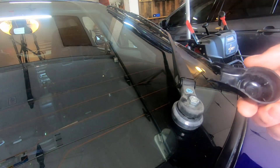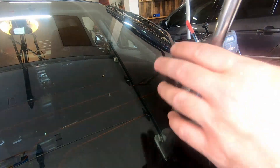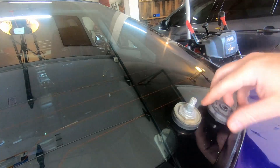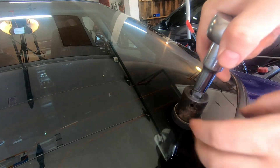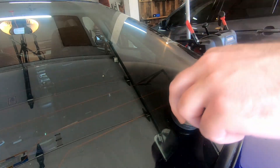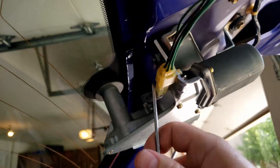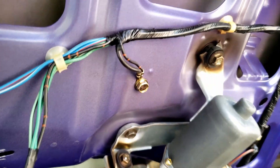Here's a cap that literally just popped off. We got this little screw here so we're gonna take that off — all right, we got our 12 millimeter here. We got that off, this guy literally pops up here, and we got a bigger nut there. Now this is a 24, so I got my 24 here — this is literally my impact one — so I'm gonna put this on here and do this. There we go — cut that off. These are 10 millimeters here now on the back side. We do want to disconnect this first — there's a little clip in here and I'm using a little flat head and literally pry this. All right, so we're just going to continue removing the bolts here.